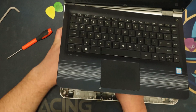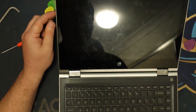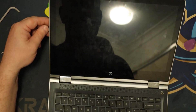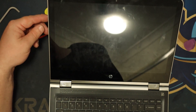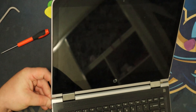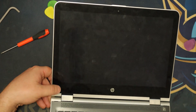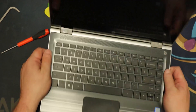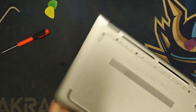Personal preference and trial and error. Once that's done, before you hard-clip everything down, re-attach those two ribbon clips — make sure the little catches are lifted up before putting the keyboard in place. You have to get down low and have a look under there; you can't do this by feel. I found it easier to get the larger of the two ribbons in first, then the inner one. Turn the laptop on — the first time it turns on it seems to do some sort of POST test, so don't stress. Once that's confirmed working, press the power button, turn the laptop back on, and it will fire up as normal. Then clip everything back down, put the screws in the back, reassemble, and put all your rubber plugs back on the bottom.